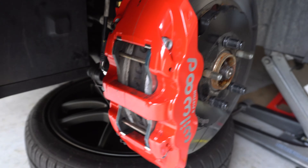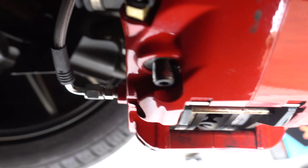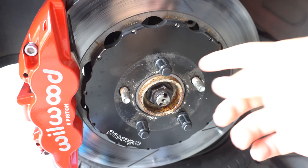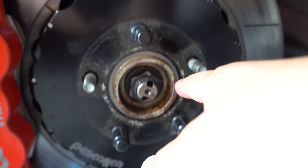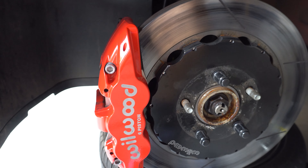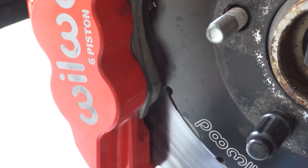As you can see, it's a radial mount. There's a bolt connecting it to this bracket, which was custom built by TCE Performance to match the offset of the rotor and hat. There's a register ring in the middle that you slide the hat and rotor onto, so you need to make sure everything lines up properly. The pad sits perfectly, and from the outside the pads are right on the edge — they look pretty good.